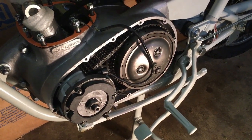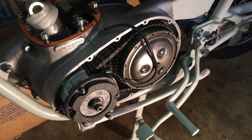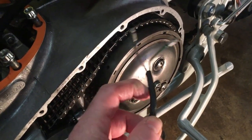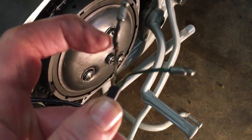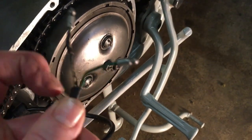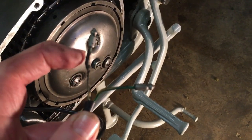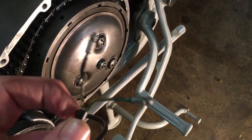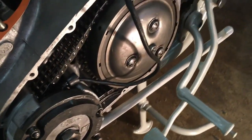So what we planned for this morning, to try and complete for the rest of this video, is, first of all, we'll sort out the alternator wiring. You can see, sorry, it's not focusing too well, but you can see that wire there has rubbed on something in the past. Might have been round about the chain, actually. This one's fine. It is okay up the top here towards the plastic sheathing. So we'll just clean that up, make sure that the core is in good condition, and then we'll just put some shrink fit around that, which will be fine, and then we'll thread it through at the back.